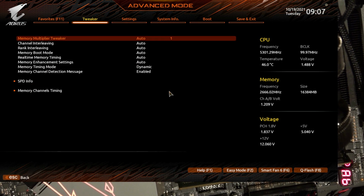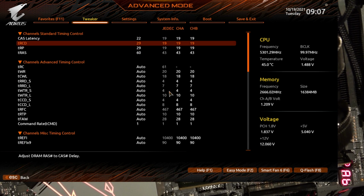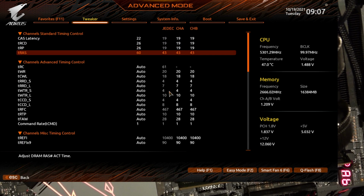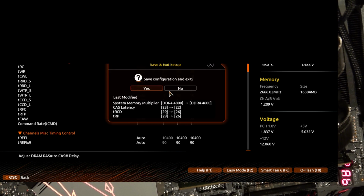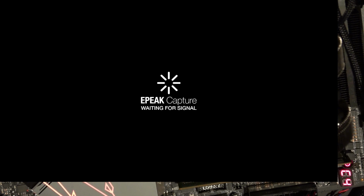So we're going to drop down to 4600. We're going to go 22. I want low TRCD, though. I'll take loose casts all day, every day, but if I could have decent TRCD, I'd really like that. Maybe I did set the TRAS too low. Again, I really don't remember much about overclocking this memory, so this is about as close to starting from zero knowledge as it gets for me with DDR4. Well, I guess there's some really obscure ICs that I could have tried finding instead, but...